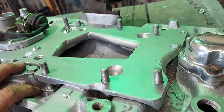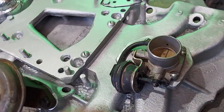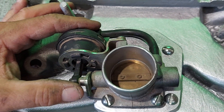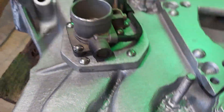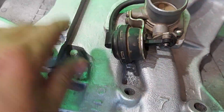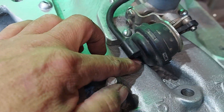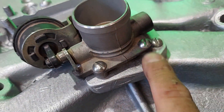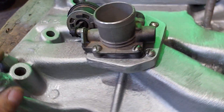The bypass valve — at idle it's open, at full throttle it'll be closed. It's simple, vacuum-actuated. I had to mount the bypass valve on this little piece of aluminum because the vacuum canister was going to hit too much on the manifold, so I lifted it slightly with this aluminum spacer and mounted the bypass valve on top of that.